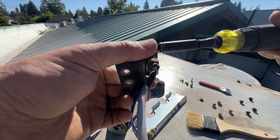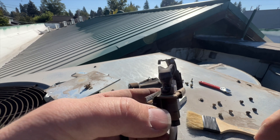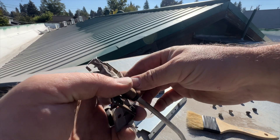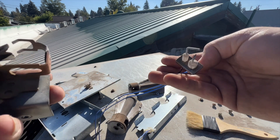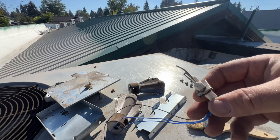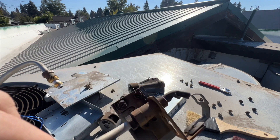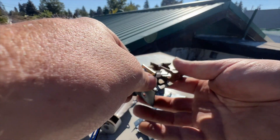There's a clip holding things in place so I'm going to see if I can pull that out without damaging anything. It looks like it slides out - and that popped right out. Now I can actually get to the flame sensor a little bit better. Still got to be careful not to damage that hot surface igniter. I'm going to go ahead and clean the pilot assembly as well.